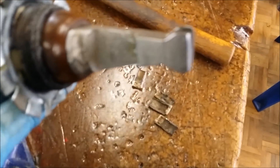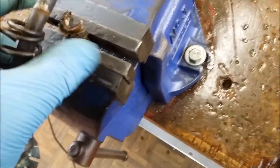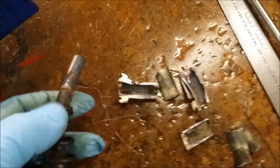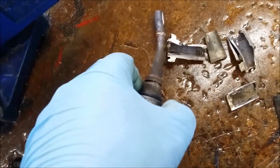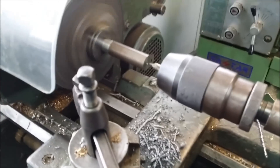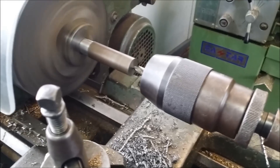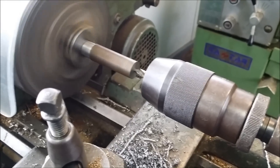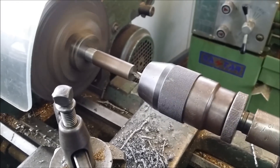The bottom of the shift is really good and positive, but I want to change this nut too for an aluminium one. So look at this — we've got this, ready to break out. I can just take those bits off — you have to keep them in order — and start working on this part here. So we've got a bit of bright steel out of the scrap bin. I'm just going to start by drilling a small hole in the bottom for centering, and follow it up with a pilot hole. Whenever you want to drill a larger hole, always start with the pilot.